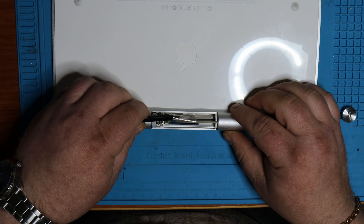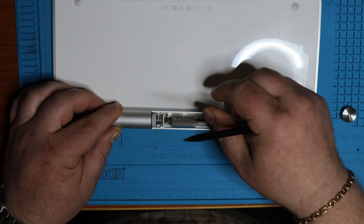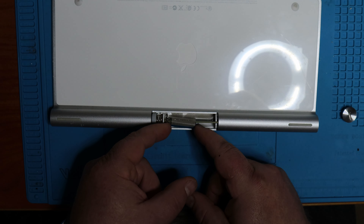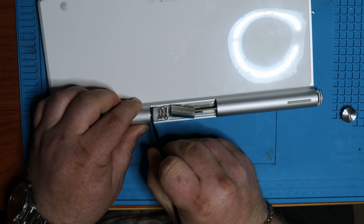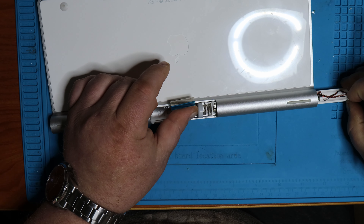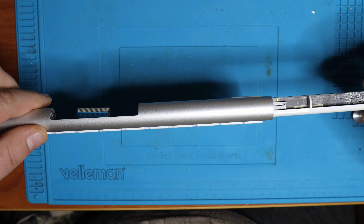If you try to take off the cable without unclamping the clamp there, you will tear the wire or the FPC — take it straight off. I used the spudger's thin end to carefully take out the cable, as you can see, working from side to side, and then the cable will come out easily.